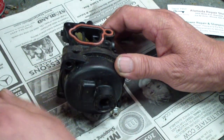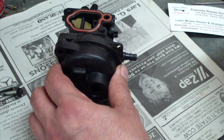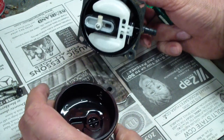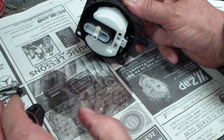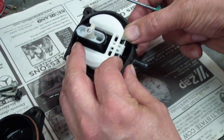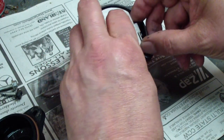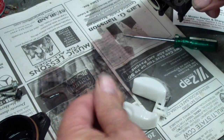It's got two 7mm self-taps on the bottom on the bowl. Take a small screwdriver, work it in there, and get that off. We've got goop and yuck — it's kind of syrupy. Take the float out, take the hinge pin, and just snap it out. Then the needle will fall out, which goes in there. That is some nasty stuff — it's got something red in it.